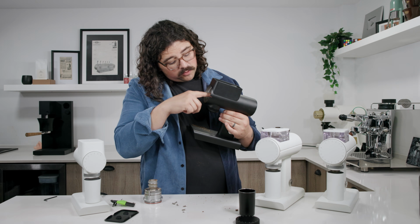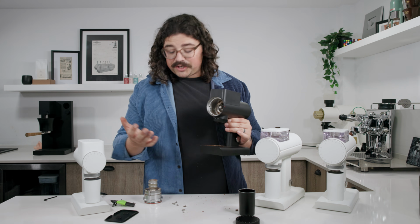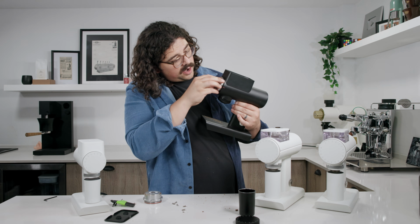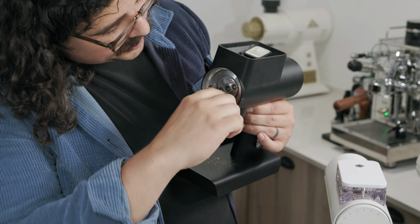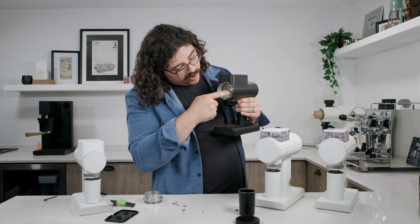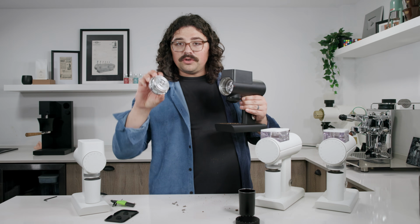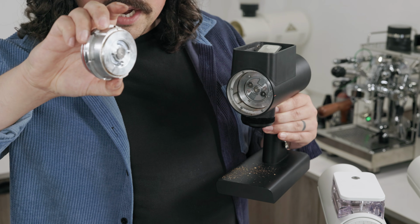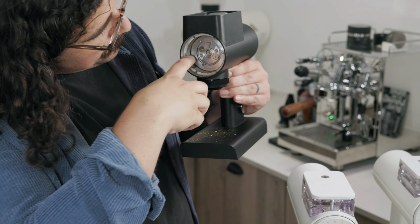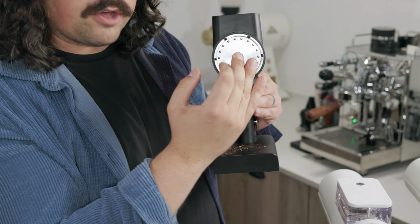So let's not forget the spring. We'll put that first. And then as you see on the inside, again, you have these grooves you have to match up. You have to make sure these flaps go into the proper area. So it needs to fit the grooves just like that. I'm going to take the clip, and you have to push until the spring is compressed and then turn to where those flaps are stuck behind the protruding parts. You're going to have to pay attention to how there's a wide flap here and a narrow flap on the bottom. What you do there is you just align it with the wide flap and the narrow flap, just like so. Okay, and then we're going to go through and put all those 6 screws back in.